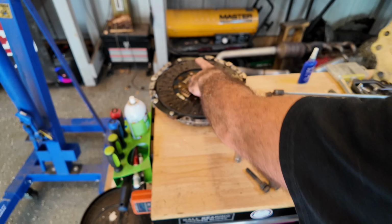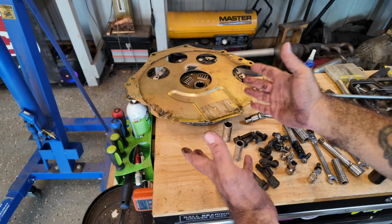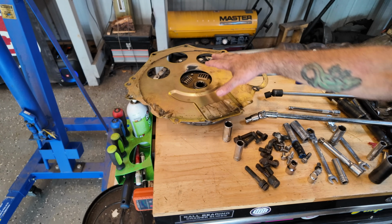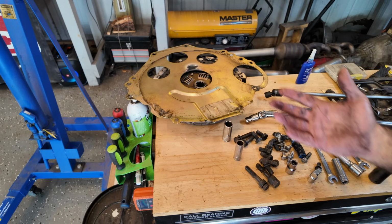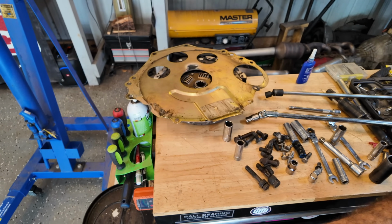I mean, now we weren't drag racing the car, but we hit it a few times from first gear with really tall gears in it. And if you guys know what I'm talking about, the taller the gear, the more stress it puts on this clutch and everything else, trying to move the car with such a tall gear. So I'm very impressed with that little clutch setup.